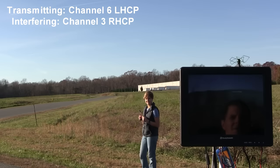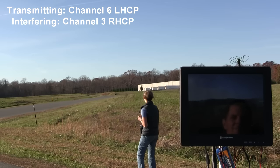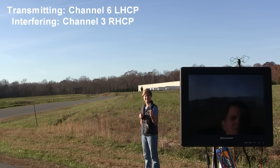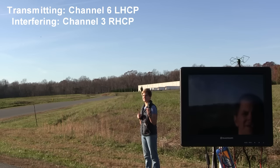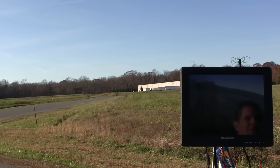Here I'm flying again at full power, but this time the interference is three channels away from my transmitting channel. And as you can see, the video is a lot cleaner than it has ever been to this point. However, my nerves are still just about shot from nearly losing my airplane on the last test because, well, I don't have an autopilot of any type, and I probably should for this kind of thing. Admittedly, I could have gone further. I told her to power it down when I was seeing multipathing and not interference. But seeing as I made it to the far end of the tree line, I think this is sufficient to say that three can be flown in the air at the same time.